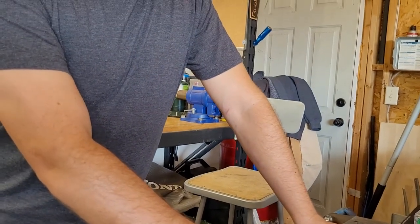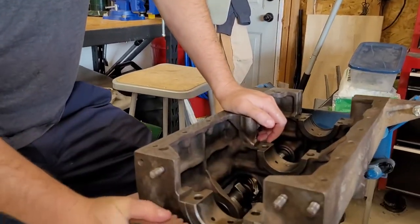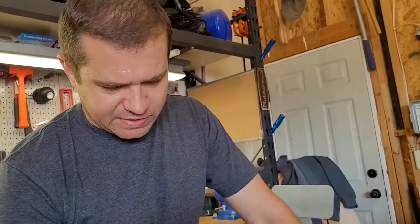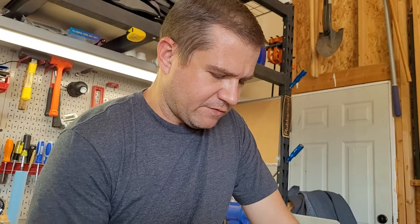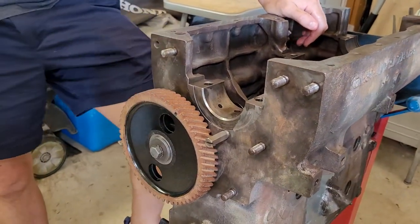So to summarize: get your tappets in first, make sure your tappet bores are all cleaned up, then put your cam in. If your cam is a little tight, don't be afraid to take the cam bearing knife out and shave the shiny high spots off after you spin the cam in there — it's a perfectly acceptable way to get these things back together and spinning right. Next video we'll probably be assembling the rest of the valve train: springs, retainers, keepers, and valves. Then we'll drop the crankshaft in, do the rear main seal, and after that it's just reassembly of the exterior parts of the engine.